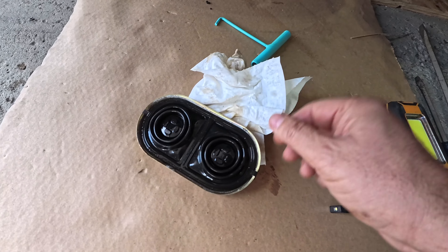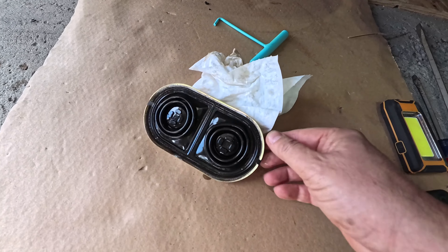The reason you have to change your brake fluid often is because brake fluid is hygroscopic, meaning that it absorbs water. There's fluid all the way up to the top. Looking at it from above — yeah, it was hard to get out, but it looks a little dark. As I explained, brake fluid is hygroscopic and it probably has a lot of moisture and water in it. So we're about to change that and make it cleaner again.